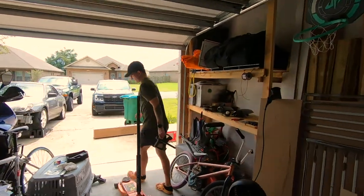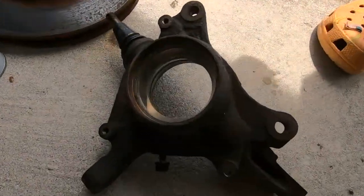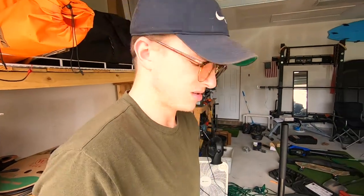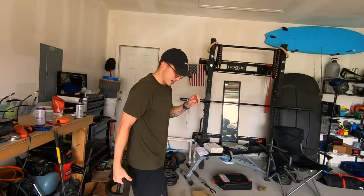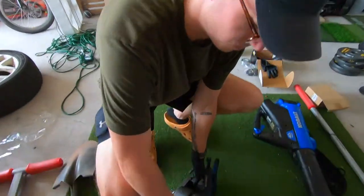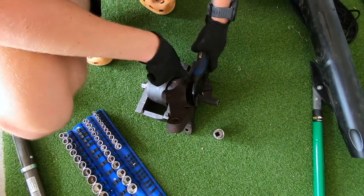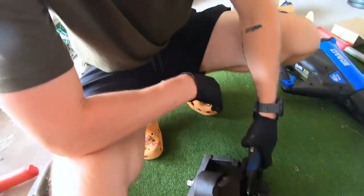New day — yesterday was a bust. We still have the outer sleeve of the bearing stuck in the knuckle — that silver piece right there. I went to O'Reilly this morning and had them transfer a bearing puller kit to my store. It's finally been in stock. Now we have to figure out how to use it. We're gonna set the knuckle up in the kit, spin it and see if it pulls the sleeve out.